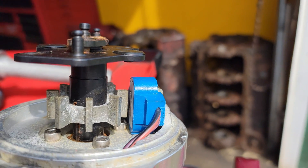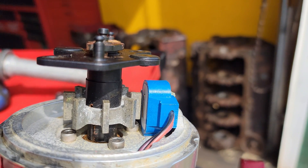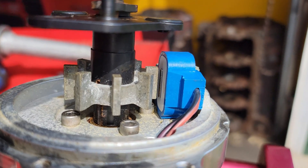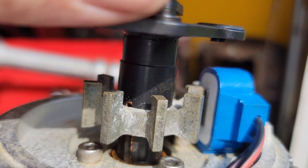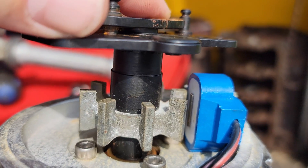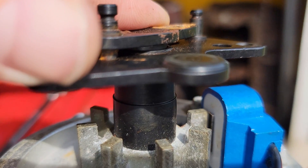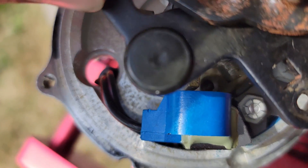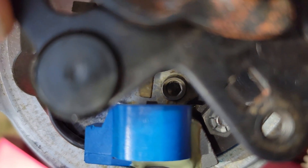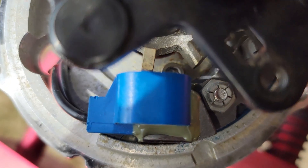Let's get a close-up look at a magnetic pickup distributor. This is the reluctor and this is the magnetic pickup. The rotor and reluctor are going clockwise in a Chevy — Pontiacs are counter-clockwise. As the reluctor passes the magnetic pickup, it generates 1 to 1.5 volts. Once it reaches 1.5 volts, it triggers the coil to fire. It is a negative to positive signal. This method will work on all MSD-built distributors and distributors with magnetic pickups, except for HEI distributors — they are different, the signal is from positive to negative. I have a video for HEI distributors. This is the placement of the reluctor and magnetic pickup to trigger the coil — almost to the edge as the reluctor passes through the magnetic pickup. This should get you within a few degrees of your desired initial timing for fire-up.